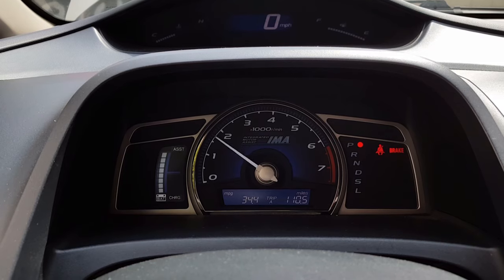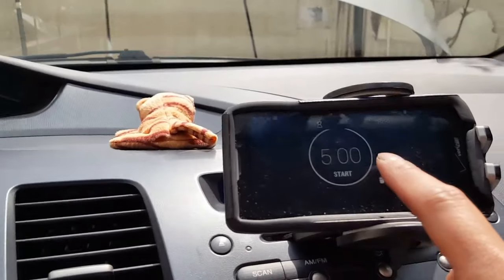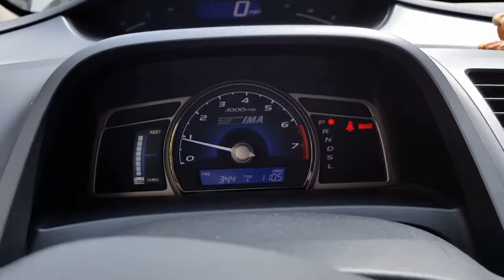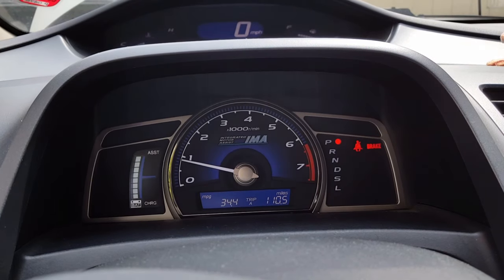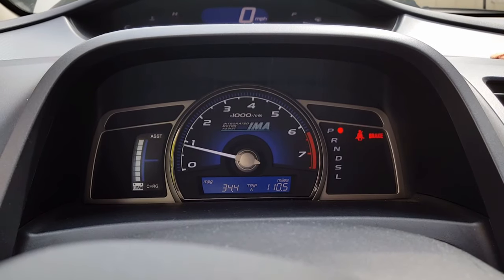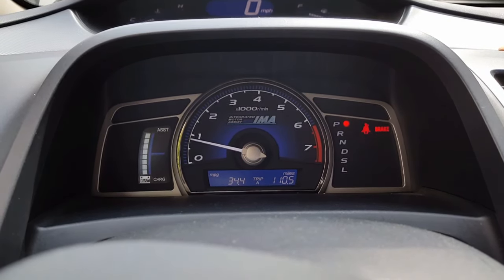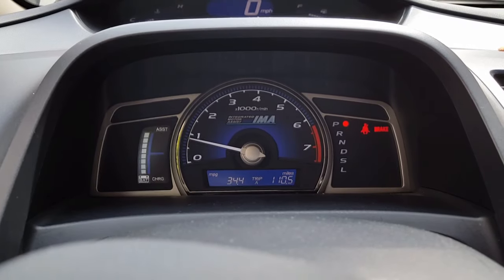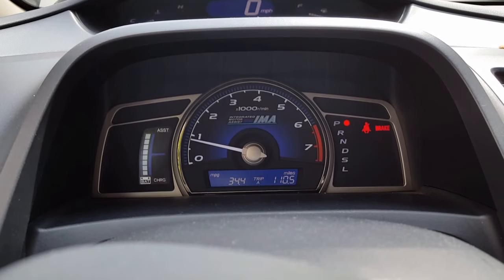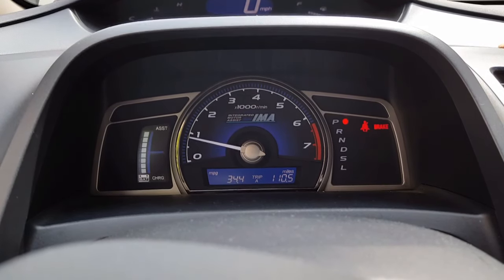Okay, I think that's ready, so I'm gonna let it idle. With everything off, I'm gonna go ahead and start the counter and let it idle for five minutes. The IMA is fully charged, idling at about 850 RPM or so — it should be 850 on the books according to the manual, plus or minus about 30. The IMA battery is charged, I have my foot on the brakes, parking brake is on, and it's in park mode right now.